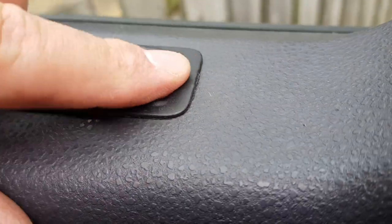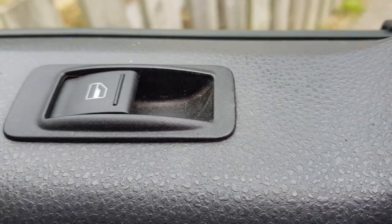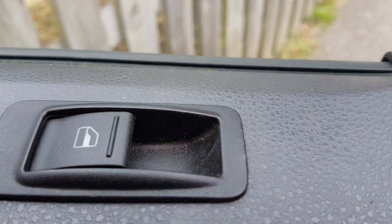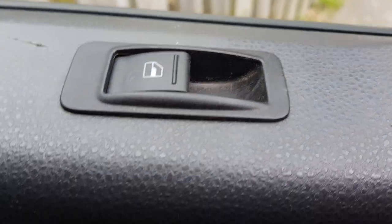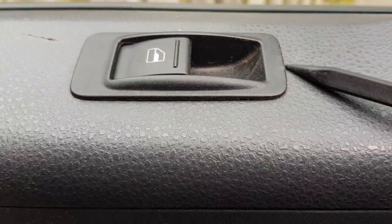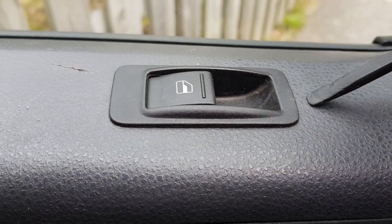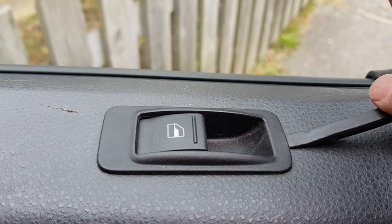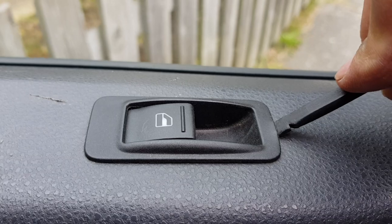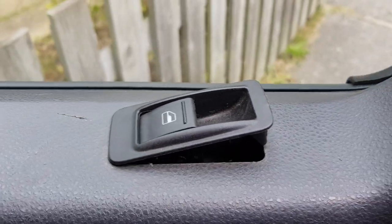If your spatula is good enough then you won't particularly mark it. You can see there are a couple of little indents there — I don't recall them being there before, but that also looks to be where the aim point for your spatula is. Don't try and go in too level — you need to be at a bit of an angle to catch the actual latch so that you can lift it up. Hope that helps.